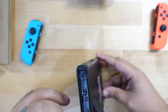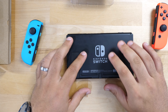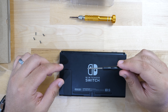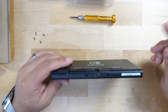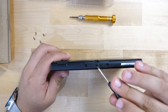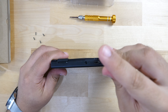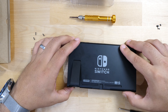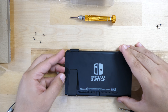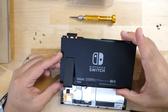So you've got one, two, three, four, and five screws — the center screw on each side. The four screws on the back are Y-shaped, a proprietary Nintendo-style screw, while those on the Joy-Con rails, top, and under the micro SD card are normal Phillips heads. Once all screws are removed, the backplate should literally try to force its way off — it comes off very easily and gently. Make sure the game card slot is empty before removing the backplate.